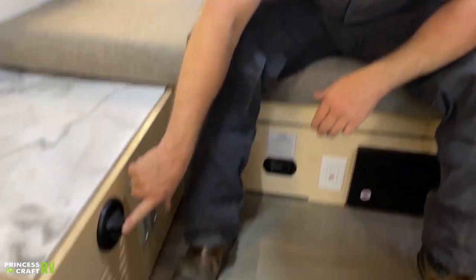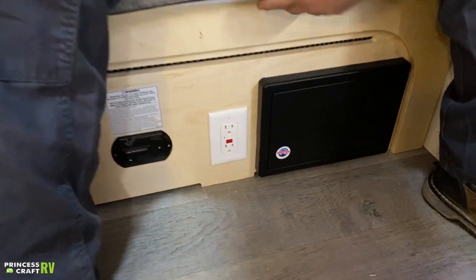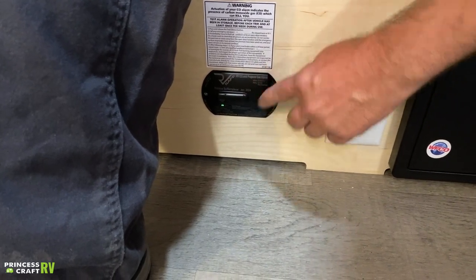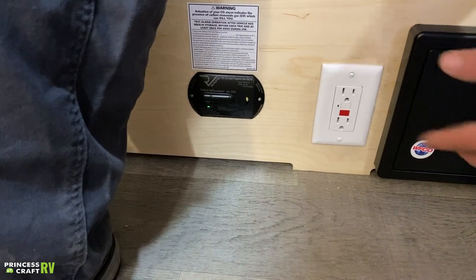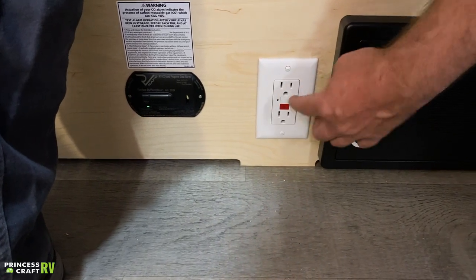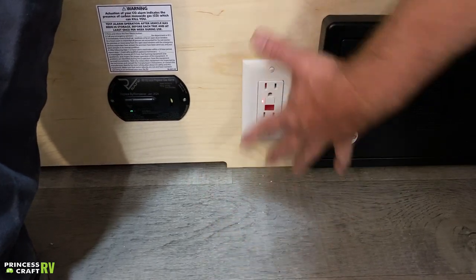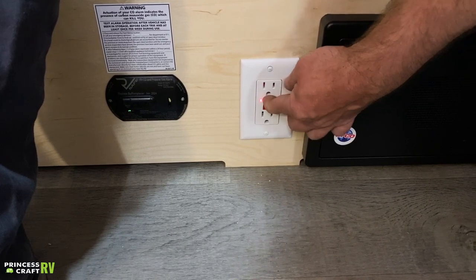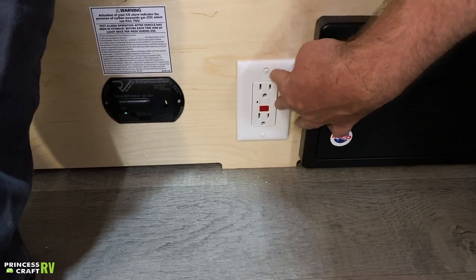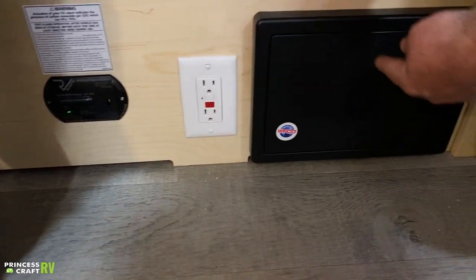All these black vents you see around are for your Air8, which is your air conditioning system. Underneath the bench on the off-door side, we have your LP alarm — it picks up on LP or CO gas and will sound to alert you and hopefully get you out of the trailer before there's any issue. Next to that is a GFCI outlet with a trip and reset button. If you see the red light, the GFCI is tripped — push the reset button to restore it. A GFCI outlet generally controls multiple outlets, so if you're having 110 outlet issues, check here first.